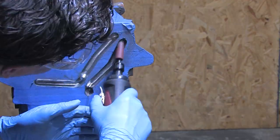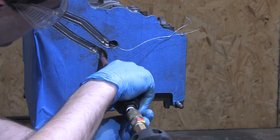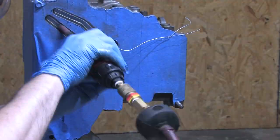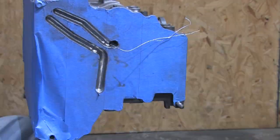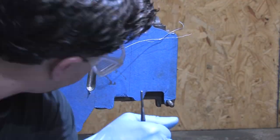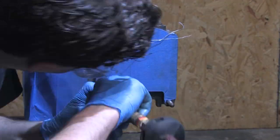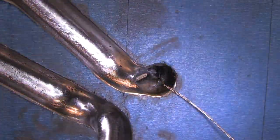Again, this is overkill on the finish, but I want to cut evenly down to the bottom of the rough cast. I don't dig deep into the block where the number one gallery is, because I'm from the school of thought that says too much of a good thing is a bad thing. A larger hole makes air and liquids flow slower. This can be beneficial for creating a pressure drop, but too big and suddenly you have turbulence. I don't want an unevenly shaped gallery, or to possibly change the flow direction across the number one main oil gallery hole by placing it directly inside that turbulence.